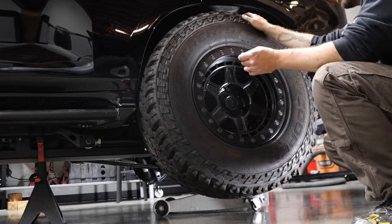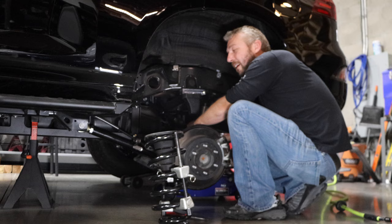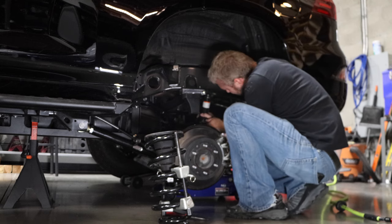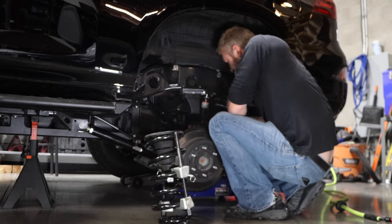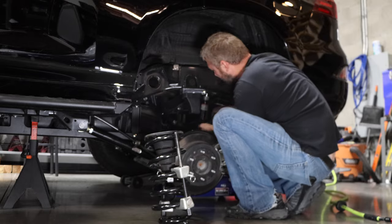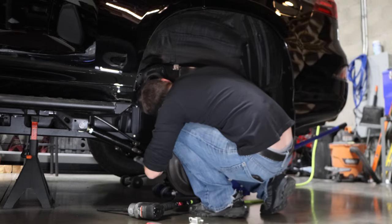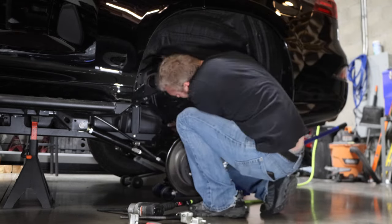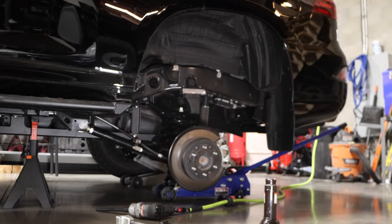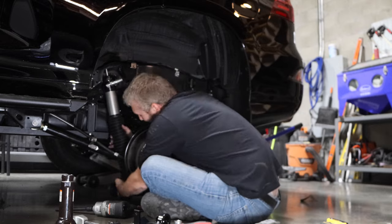For the rear bump stops, after I adjusted and moved my axle back by just over a quarter inch to avoid hitting the door, I tried Dura Bumps and Toy Techs but they were all too short. So I cut the Toy Tech in half, installed the Dura Bump on the Toy Tech, and that gave me the length I needed to avoid hitting the upper portion of my fender. If you have hydraulic bump stops, this would be much easier since they just adjust by screwing up or down. I gave myself about an inch from the upper lip, because the bump stops are going to have some cushion.